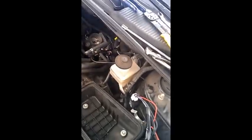If you do it from outside, just pull the wire enough so it reaches the front, and then hook up the switch, and then I'll show you the rest. So I put the fuse right there. I used that 10 millimeter screw that's used for the brake hole. I just used that to put my fuse in, holding it in place. The power wire on the switch was not long enough, so I put a connector in to make it long enough. And I'm taking all the wires through there, all my fog lights. They come down here, and one goes from the back and over there.